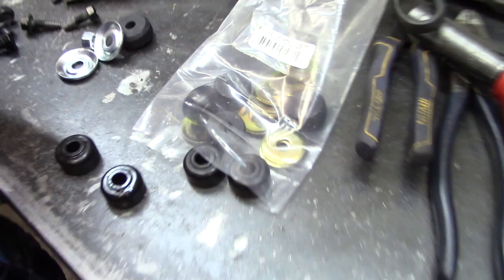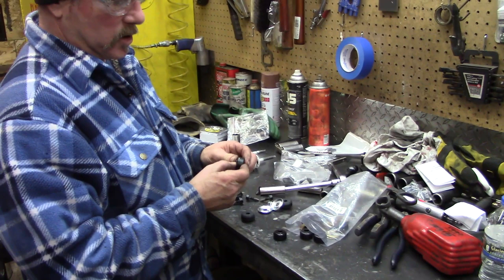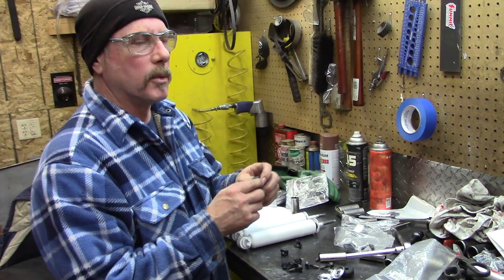This is the last stuff in our polyurethane kit. They measure it — it's called durometer, the hardness of the material. This is like plastic almost, so it's not going to give. You want everything to be doing inputs, not squishing. I've been in 4x4 trucks where guys had rubber bushings, flew over jumps, and all of a sudden these just squished out.